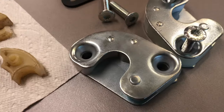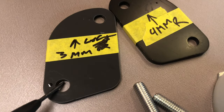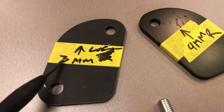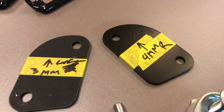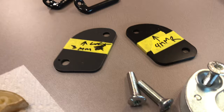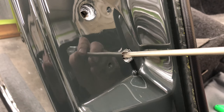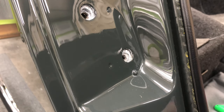It wasn't too bad — a bit of a wrestling match getting them apart, but once you get it apart you'll see what needs to happen. There are also some shims that go on the back side of these — these are replacement shims from Porsche and I've labeled them left and right. This was the thickness of the shim I took out of the car when I disassembled it. I'm imagining we'll be right in the same location when we put them back since I haven't done any body work to the jam. Just like our seat rail extensions, these have an adjustable backing plate. Clean the threads out with a tap first — there's quite a range of adjustment in there. We can just set the strikes in, snug them down, and do the final adjustment and torque once we get our door in place and fully adjusted.